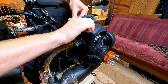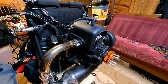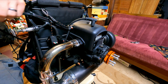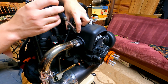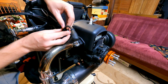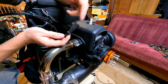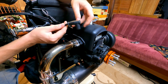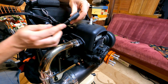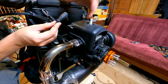Usually they're just zip tied on. We'll pull our spark plug boot off, and then we're also going to undo this bolt. This bolt goes into the head of our Atom 80 here and holds the spark plug wire in place. Also take this small clamp off. Now we have to take the spark plug boot itself off. I found it easiest to slice up the back ridge of the spark plug boot — that just lets it pull right off.